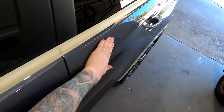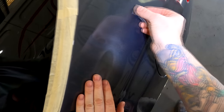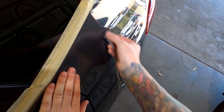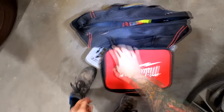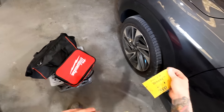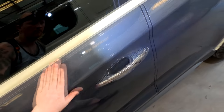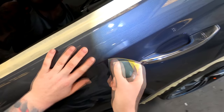Another thing that's advantageous — like those belt moulds — sometimes you can get some of the compound up underneath the belt moulds on the tops of the doors, and the rubbers around the quarter panels around those quarter glasses. So it's handy to put masking tape on there, not just to protect the part but also for cleanliness. You've always got to think about the next person in line. I don't like it when a panel beater brings a car covered in bog dust into the paint shop. I try to hand my work over to the detailer in the best condition within reason.